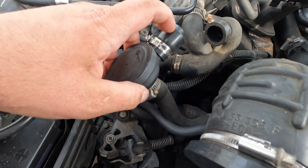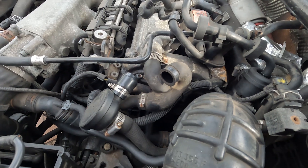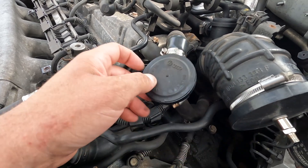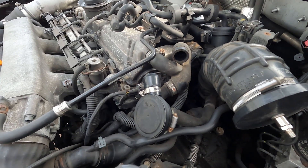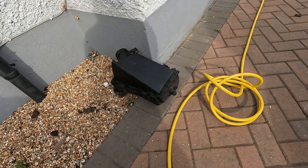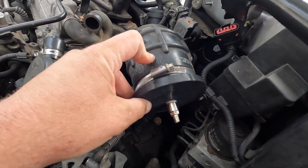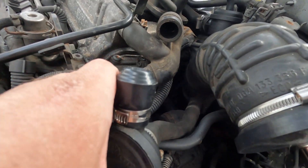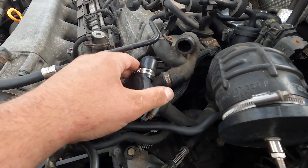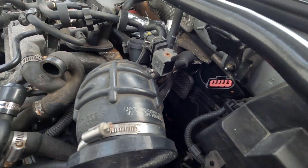You don't have to put the bung on the turbo intake pipe — you can put it on another pipe here — but basically we don't want to be over-pressurizing the rocker cover and blow the gasket. That's the risk. By doing this we are taking it out of the equation and we're not going to over-pressurize it, because the last thing we want to do is cause more problems. I've removed the airbox, put the bung in there, and I've unplugged the MAF because I left it plugged into the airbox.